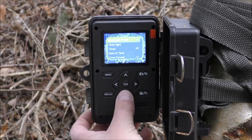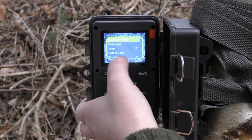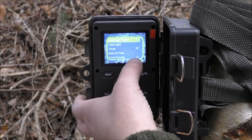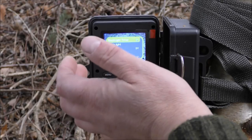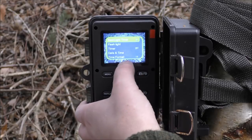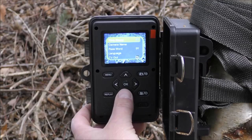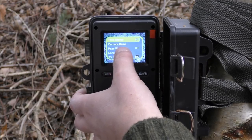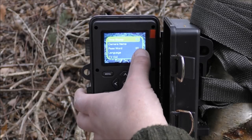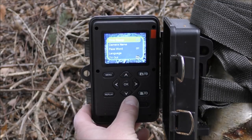Auto power off is set to five minutes — that just saves the battery a bit. The next page has basic options: backlight timer, flashlight timer, date and time. I normally have the date and time display switched off, but you'll see from some of the photos later in the video that I forgot to knock that off. Time format can be 12 or 24 hour. You can also set the timestamp on or off, name your camera, have it password protected, change the language, and change the settings if you want to link it to your TV or laptop — it's got PAL or NTSC.